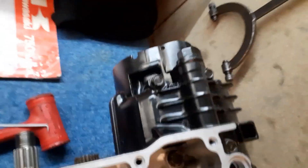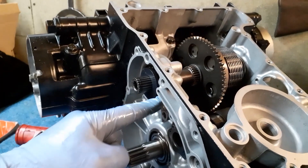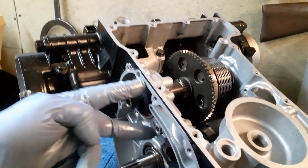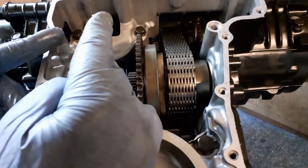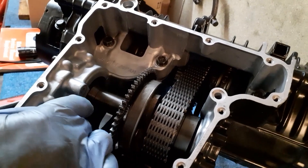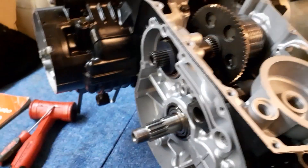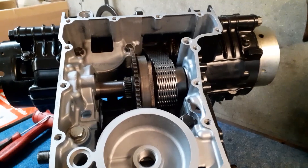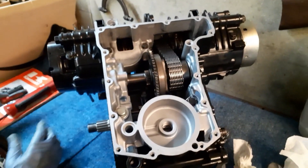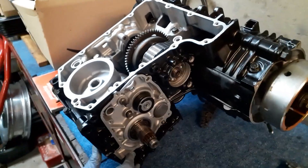You had to press this little cog off — just had to knock that off the end of this shaft here, so that goes on the outside of the case. That's your drive to the clutch basket. There's the shaft installed with the bearing. That washer goes on, and there's a retaining plate goes on here to stop that bearing moving outwards. Two of the bolts are long and there's a very long dowel — about 30mm — which protrudes out and locates the oil pump, driven by that little gear. Once I put this plate on and the oil pump on, I can slide that on, a circlip holds it in place, then the sump can go on, and the whole thing can go back in the frame.